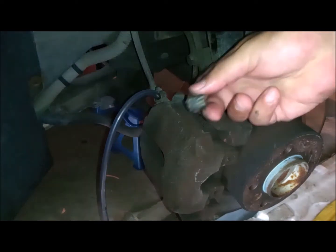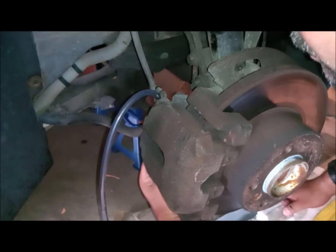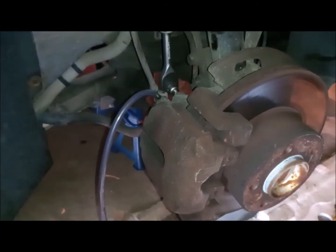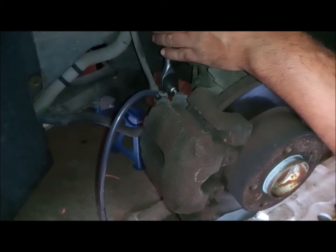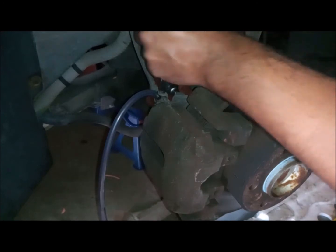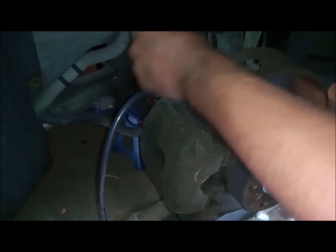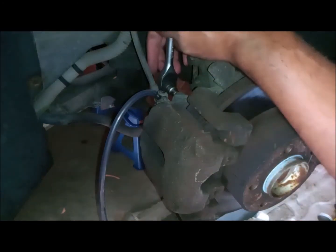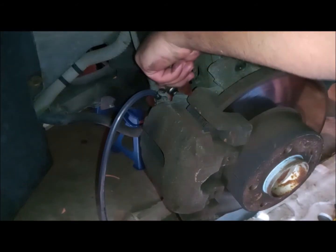as you see here, to remove the guiding pins, I will remove the plastic covers here. The guiding pins are 7 millimeter hex. On this side, the lower cover was already not available, which means the Allen key, the H7, is dirty, which will make me big problems just to remove. So of course, in any process of changing your brakes, as I'm gonna do, you always order the parts before. That's why I have no problem. I already have the new plastic covers and the tunnels for them. I will remove the upper Allen key H7. This will be enough as long as it's out.